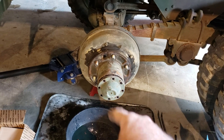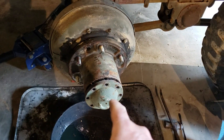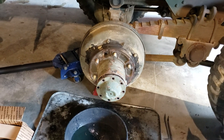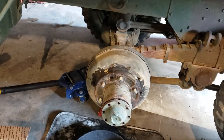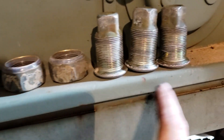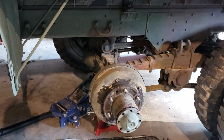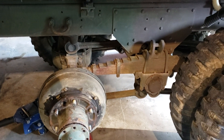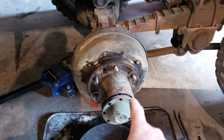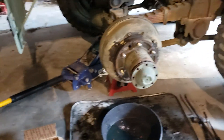As you see, I've already got the rear cap bolts off and a little bit of gear oil came out, so keep that in mind. The rears are different from the fronts. When you take the axle shaft out, gear oil is going to come out, and I'll show you how that's constructed and why these things get gear oil in the bearings when they're not supposed to. Look at how nice these thimbles are — it's an '87, but the thing is like almost new. It has been serviced before; everything I've taken apart so far has had orange silicone on it, and they came with gaskets, not orange silicone. Look at the drain cap there — orange silicone. So this thing has been serviced before at least once, which is good.